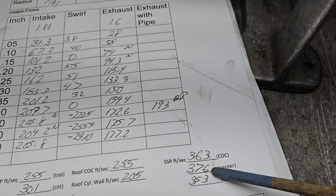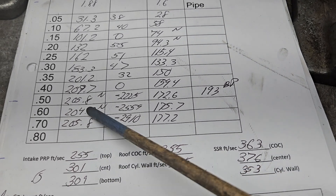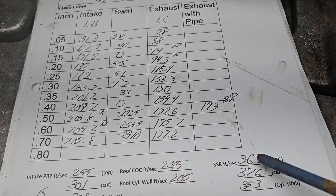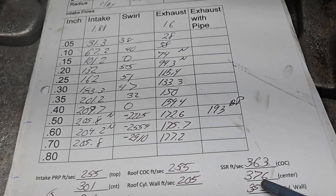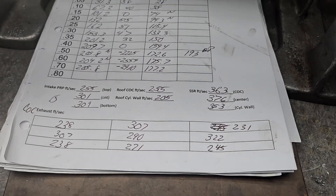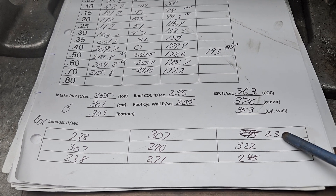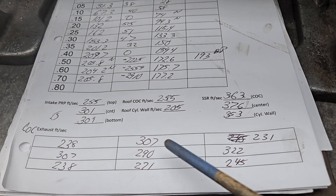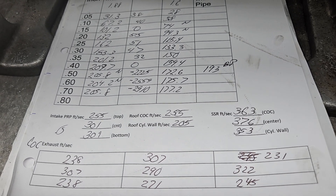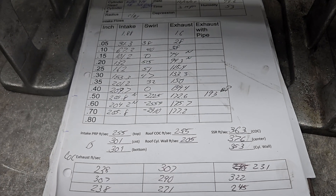At 500 lift it's already lost it, so you're at 205, but it's relatively even across it. Like I told Mike, just properly polish the short sides and you'd have a decent head. Take a look at our exhaust — side to side, not bad, not bad, not bad, not even dead in the middle. Overall, a nice little package for an amateur porting job.